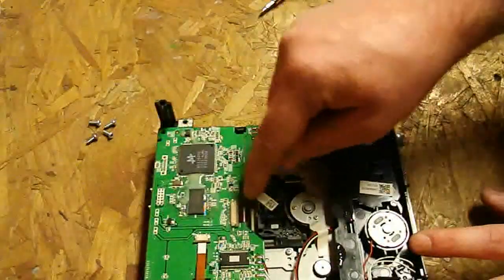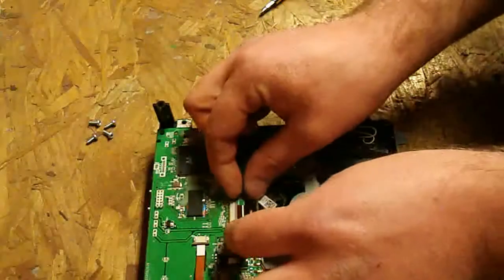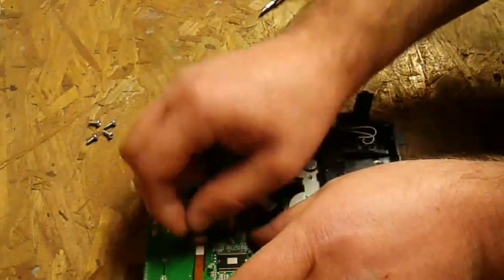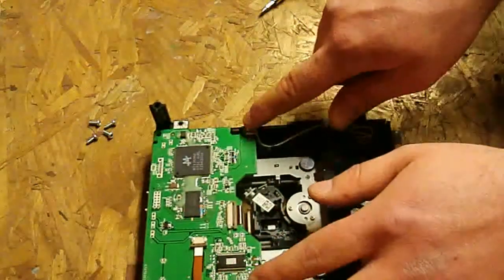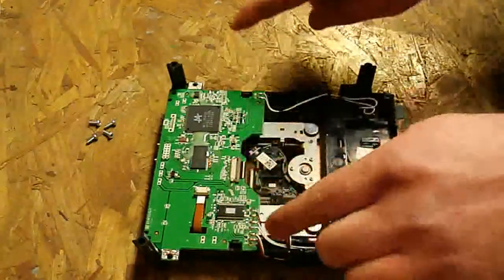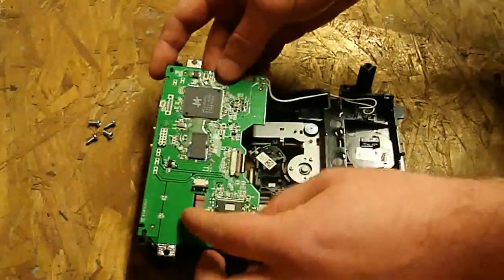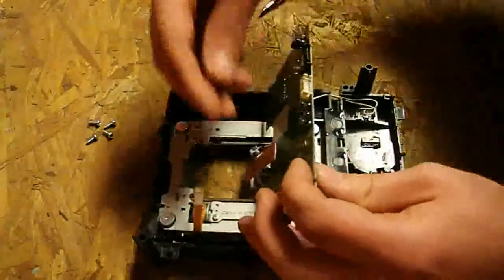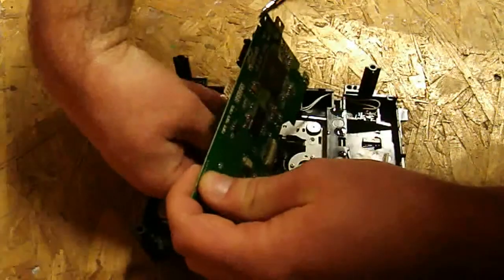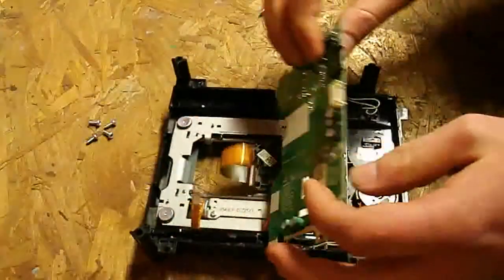What we're going to do first is remove the laser ribbon and the worm motor ribbon. There's a little brown clip here and you're going to slide that out on both of these. There are two clips on either side and you have to pull them both outwards, then pull the board up at the same time. As you can see, the worm motor already popped out. The laser ribbon is probably kind of glued, so work that out carefully. Now those are detached.